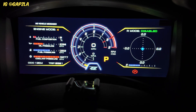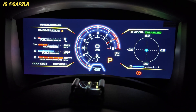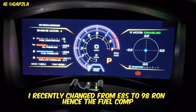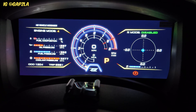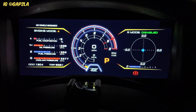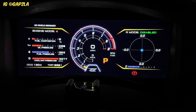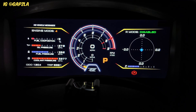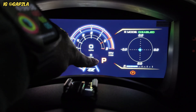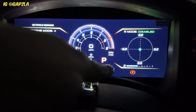If I press it again, it will go to the fuel composition screen. Right now I've only got 9 or 10% ethanol, so it's showing fuel composition 9. Then I've got my oil pressure reading in KPA, fuel pressure which I talked about just before, and then coolant pressure. I don't actually have a coolant pressure sensor in at the moment, which is why it's blacked out. Also over here it's obviously got what gear you're in — I'm in park at the moment being in my garage.